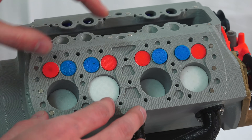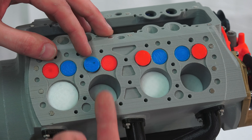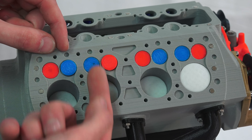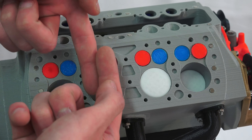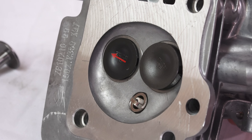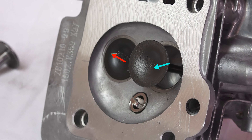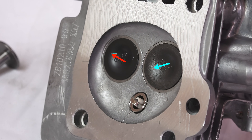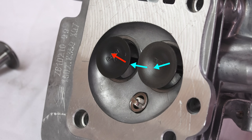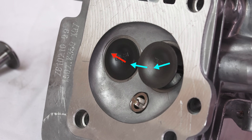Another airflow challenge is that intake and exhaust flow travel in opposite directions. After your power stroke you're pushing air out the exhaust in one direction, then the exhaust valve starts to close and the intake valve opens, suddenly reversing that airflow into the cylinder. In today's modern engines the airflow goes in the same direction — intake air comes in and exhaust air is traveling in the exact direction the intake air will enter. So you get that nice scavenging effect, a smooth transition from exhaust to intake, rather than having them collide with one another and act in opposite directions.